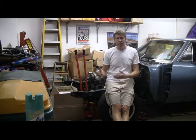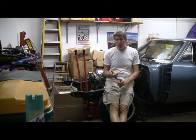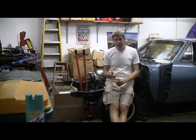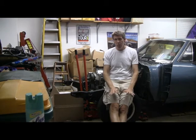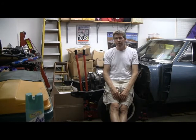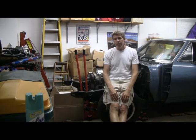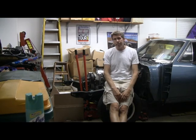With those engine mounts and the Holley oil pan I was able to get that engine back just a little bit more. Everything's in the correct location — the shifter comes up to the hole in the floor, no cutting up the floor anymore. The driveshaft length will be correct because I have the front-to-back location of the engine right. The power steering box and lsbrackets.com accessory drive all fit even with the lowered engine. Fantastic. Take the time everybody — do this basic stuff and make sure you get it correct, because down the road it will make things so much easier. Next we're going to pull the motor since I'm done with test fitting, then rip apart the front end and do the Global West conversion. Stay tuned.